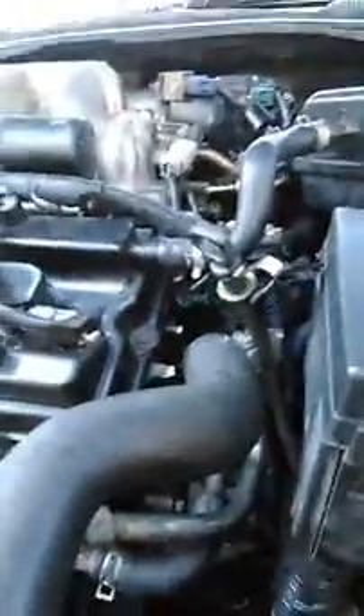Those are the two camshaft position sensors — they're reading the cams located here and here. The crankshaft position sensor looks just like these but it's not the same; it's very slightly different. While it shouldn't be able to fit if it's not the right one, it will fit, and you'll have the same code come back up thinking you fixed the problem but you didn't.